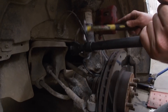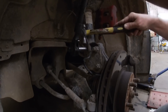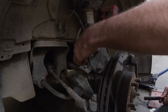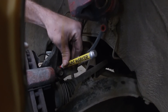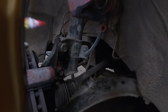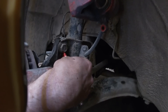A lady came up and offered me money — and I'm not making this up — because she thought I was homeless in my 2000 Subaru Outback. That is a true story. If you are doing this repair, be sure you mark the orientation of these two bolts. The bottom one doesn't really matter — it's the top one that matters the most, so that when you put it back together your alignment is pretty close.